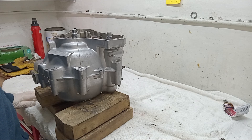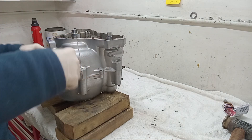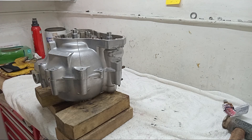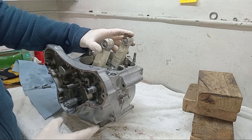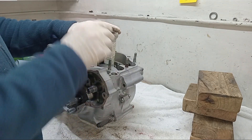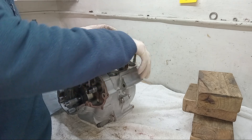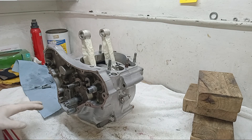That's all looking good. I'm going to put in some of the crankcase bolts now, and then we'll mate it to the engine cradle. I've put in most of the crankcase bolts — I need to order a new set — but with the ones we've got tightened up, the crankshaft is going really nicely. The big ends on the conrods are really nice as well. Always check the camshaft is turning nicely too, which it is. I'm very pleased — it's really smooth and really nice.